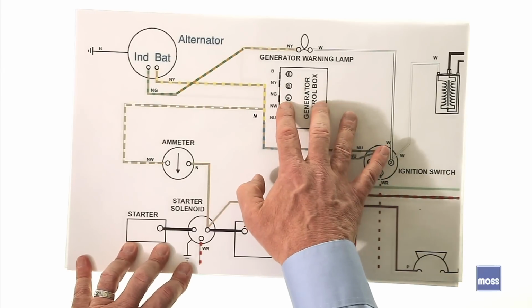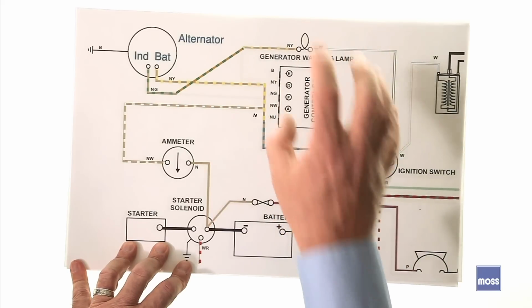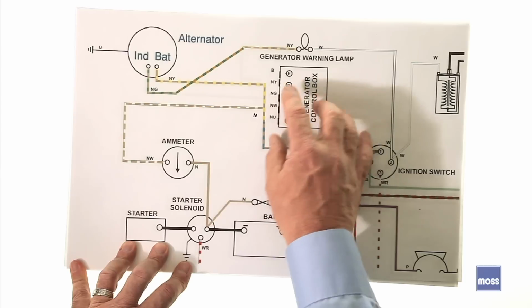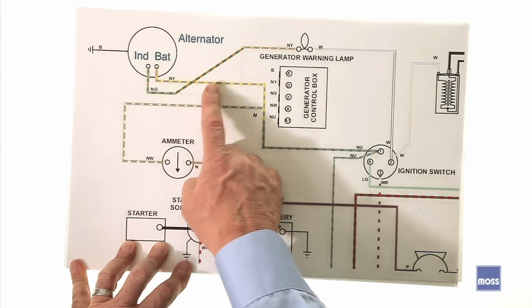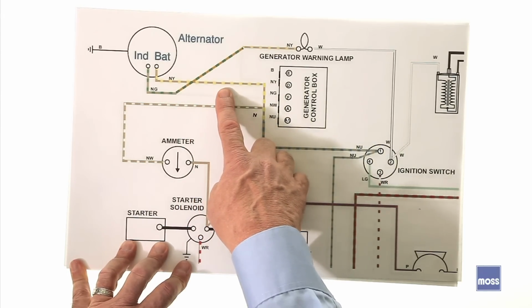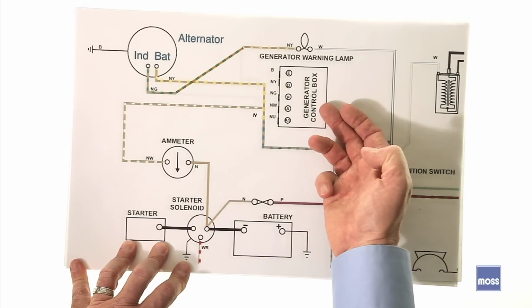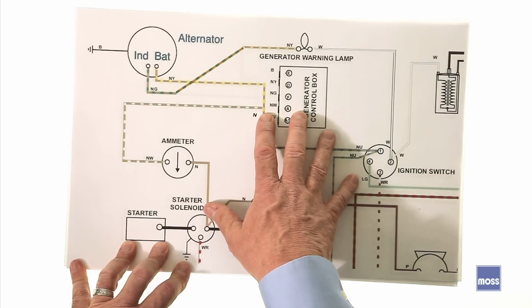Some people like the voltage regulator. They don't want to take it out of the car. It looks good in there, or at the very least, if you take it out, it leaves a hole, and we don't want that. If you'd like to leave this in your car, you can follow the wiring harness back a few inches, open it up, and cut all your wires there. Terminate them in there. Then you can go ahead and make your connections inside the harness, like we just talked about, and close the harness up again. Anybody who's looking will say, there's a voltage regulator. She's got wires going into the harness. It looks perfectly fine, but it does nothing. It's just simply something to look at, an old relic.